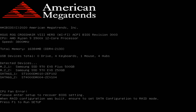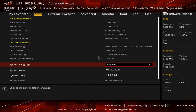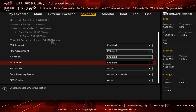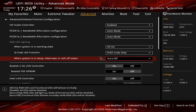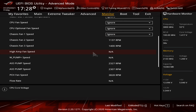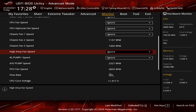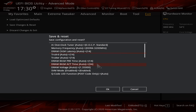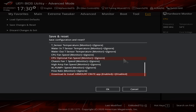As it's booting up it's going to complain about a few things because your BIOS settings will be reset. It says CPU fan error — press F1 to enter setup to recover BIOS settings. If you're using a wireless keyboard that might not work, so make sure you have a wired keyboard plugged in. Once you're in here, set back your settings to what they were before — virtualization, RGB settings, fan sensor ignores for an AIO cooler, etc. Once done, go to exit, hit Save Changes and Reset.